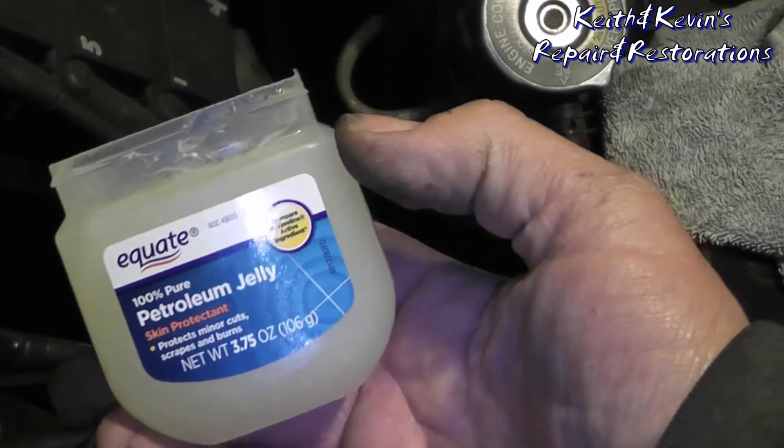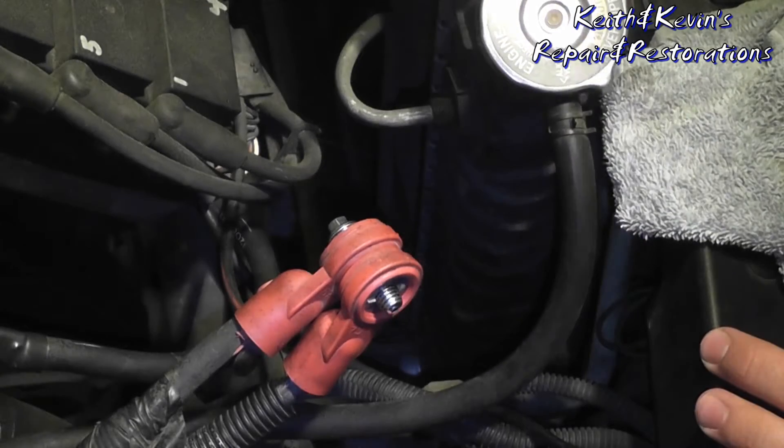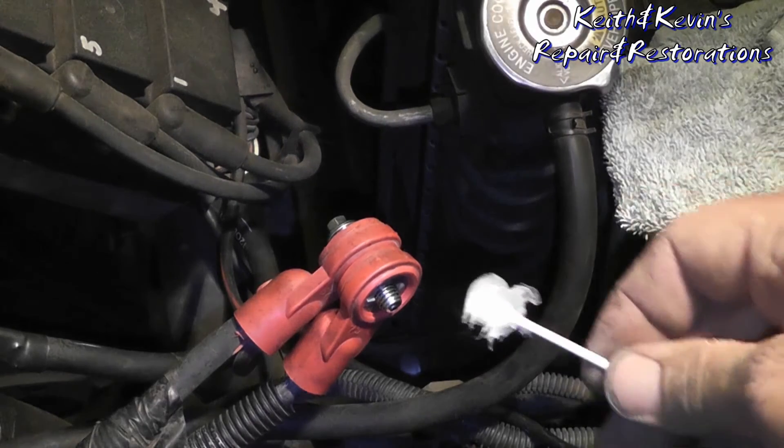One thing I found is good old Vaseline — it stops corrosion right in its tracks. I've seen with other batteries where I've done a service that the Vaseline has actually become sacrificial and was the only thing that was corroded up, but not my battery cables. You want to split those apart?